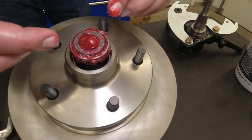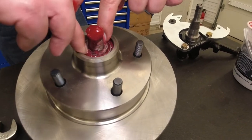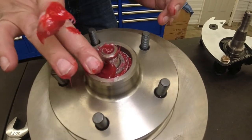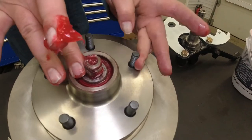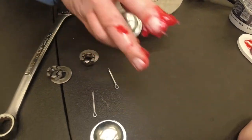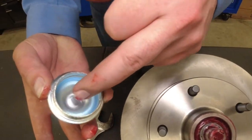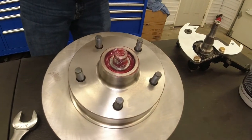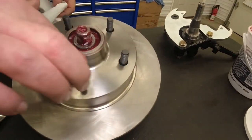What I like to do is take and put just a little bit of grease on the very top of this edge to build it up around there, and then put that on there like that. Some of that grease is going to work its way down there; the rest is going to lay on top of the spindle — we'll just push that in. Take a little bit of grease and push it in here. We'd rather have a hair too much grease than not enough. Your dust cap does have some capacity to hold some grease up in there. I'd rather have a little bit of grease leak out than have a bearing lock up at 85 miles an hour. We'll just wipe off the excess grease.